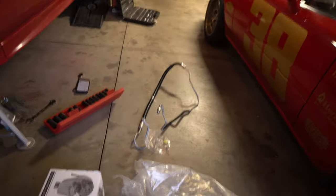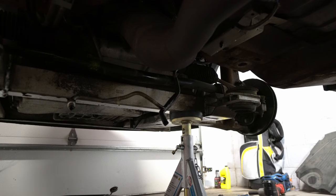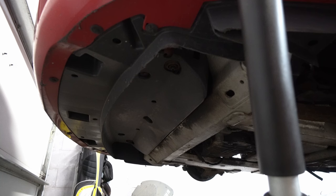The low pressure hose I can just disconnect right here. The bad news is I bought the high pressure line, so I need to go back to the store. As I showed earlier, the hose that was leaking was the return line. I disconnected it from the steering rack and realized I had bought the high pressure line assuming that was going to be the one that leaked. The return line loops along the front of the subframe. It failed because that plastic shroud trapped moisture and presumably road salt, causing it to corrode.